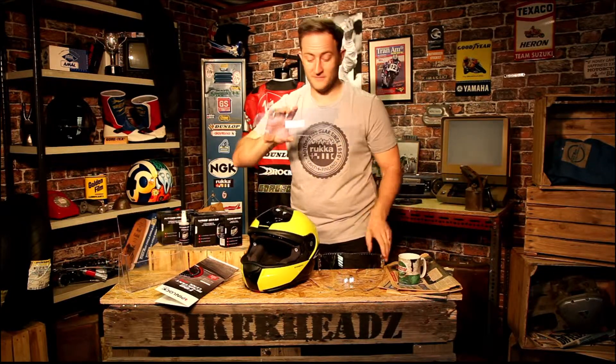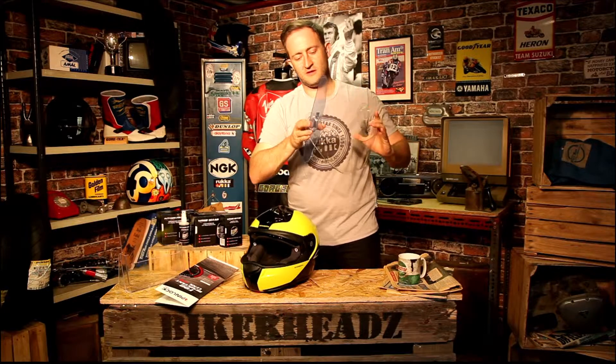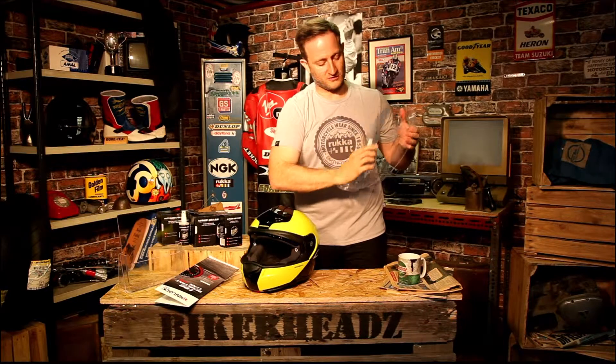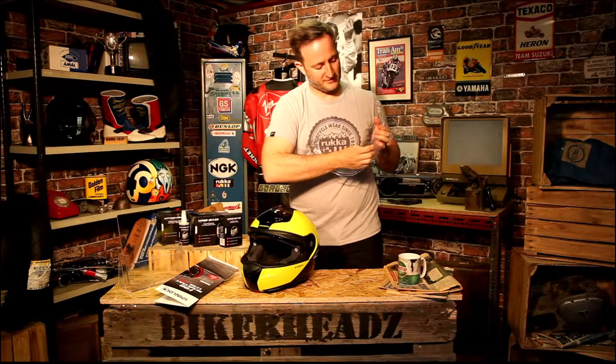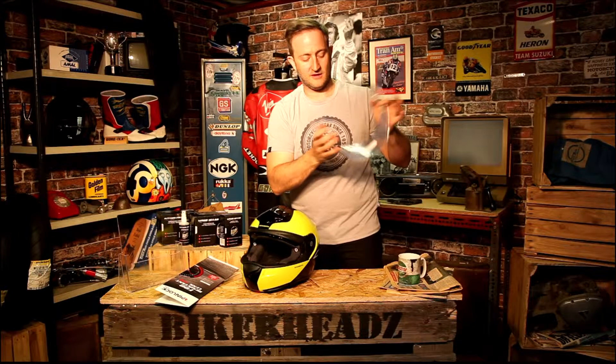So take your pinlock and your visor — it does have a blue film, but I always put the pinlock in first. Just stretch your visor out slightly, slot the recesses over the pins on both sides, turn it upside down, and you can just bend it slightly and it should snap in like that. Give the visor a wiggle and that's it — it's set in its place.